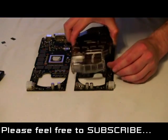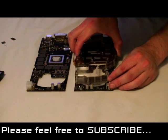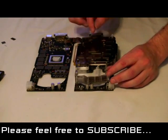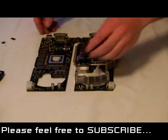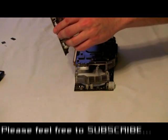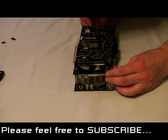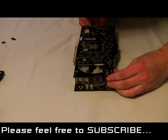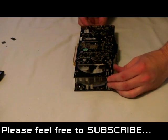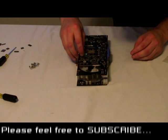So let's install the water block. Line it up with the screw holes that you just took the screws out of, then position it on the card. Make sure that it's matching up with all your thermal pads. Now be very careful with the ribbon on this one — you've got your connection ribbon for your two graphics cards. Just make sure you line everything up and those connectors for the ribbon remain in place.